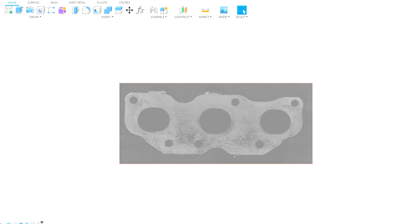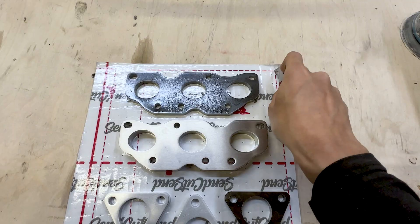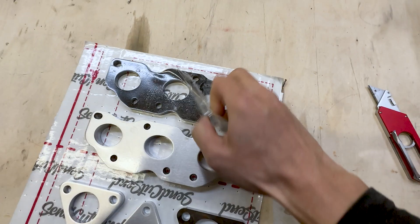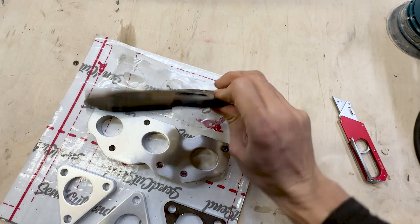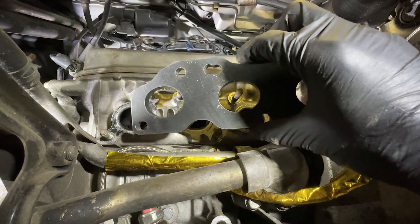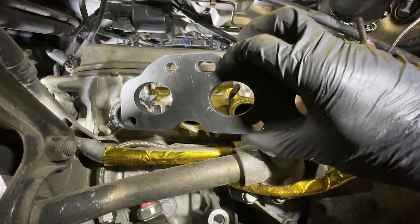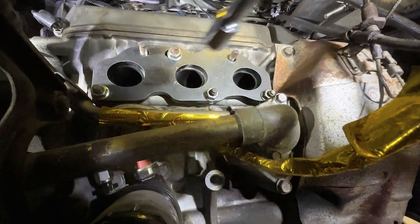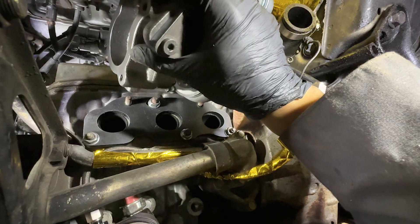Using the old manifold, I scanned the flange, modeled it up, and sent it out for laser cutting. I ordered the flanges in both mild steel and stainless steel, and a few of each just in case I mess up, which is usually a high possibility. Case in point, I had to widen one of the holes for the mild steel flange, but it didn't affect the overall fit-up. I think I undersized the hole diameters a little, so widening them all out a little bit worked well for the stainless flanges.